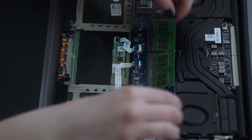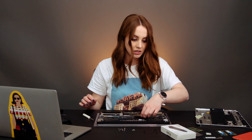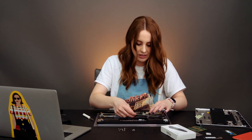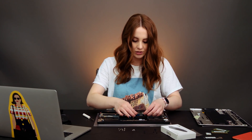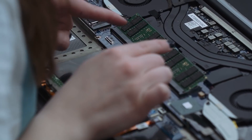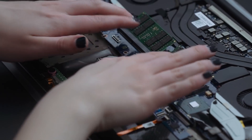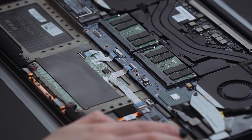Moving on to the RAM. You can take all of these old parts and sell them on eBay or Craigslist, so you can really make back some of your money. Later, we're going to show you how to take advantage of the SSD that you remove and use it as an external SSD. Place the RAM in — you have two sticks of 16 gigs for a total of 32. The videos I watched usually have the label on the outside, but these fit in with the opposite — the label is on the inside. We're just going to push it in. What a satisfying sound. We are two out of three, almost done here.